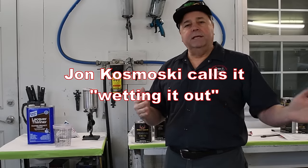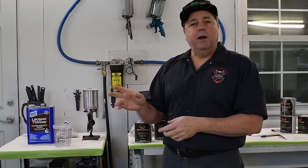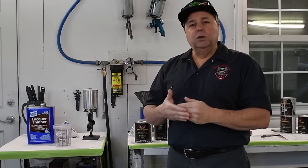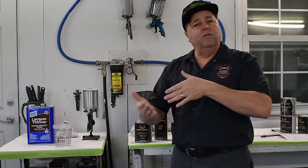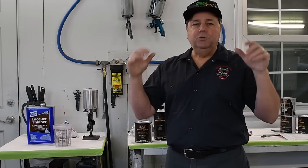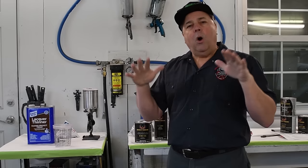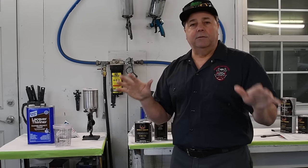And you got some nice 75% overlap, you're moving fast, you got a nice fine spray on your gun, you got a nice wide fan, you'll watch me do it. I'm moving. I like to move like that. You'll see a lot of other guys move pretty quick. Lots of overlap with a fine mist and moving fast. What you get is a nice, even, wet coat, and it's nice and wet, and all of your little droplets that have atomized melt back into each other nicely.